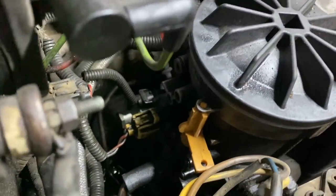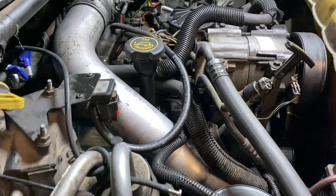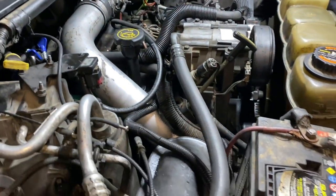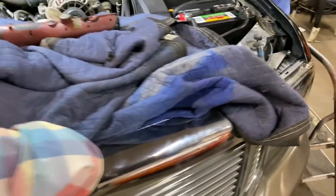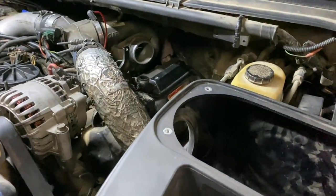That was down on the actual fuel filter housing. Hopefully it doesn't leak anymore - you can see these o-rings are just completely washed, completely flat, with not much left of them. So that's where it was leaking from. We checked the glow plugs and we've got power going to all the glow plugs through the main harness. The only thing we've got left to do is put the cold air intake stuff back on and we'll be done.